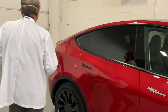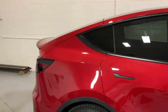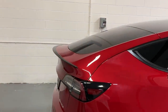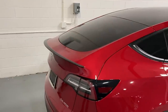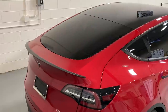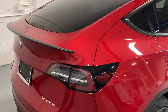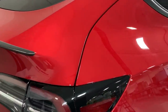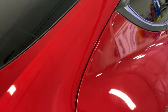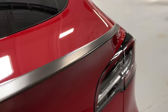Let's look at the rear hatch gate. The lift gate wasn't as happy. At the top of the lift gate, at the fascia side, we're looking at a difference of one millimeter on one side and three and a half on the other — that's a kind of a big gap. When we look at the bottom, we're going from three to four, one millimeter at that point, probably not as significant.